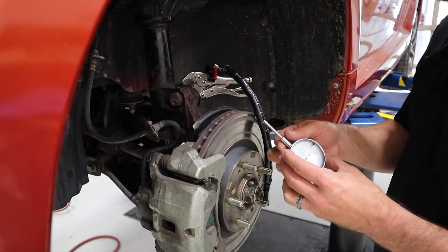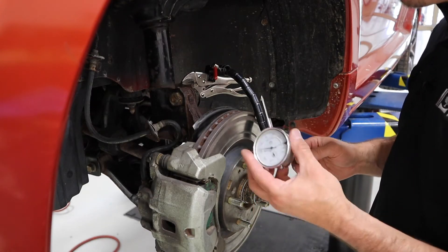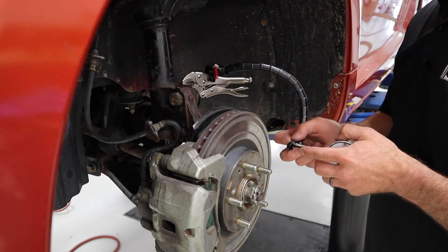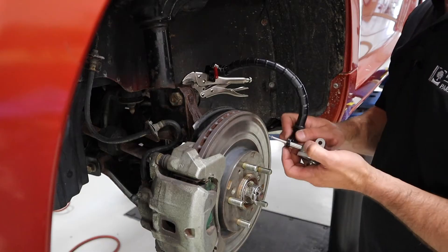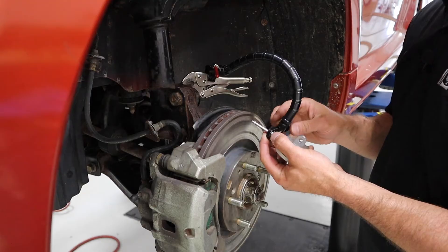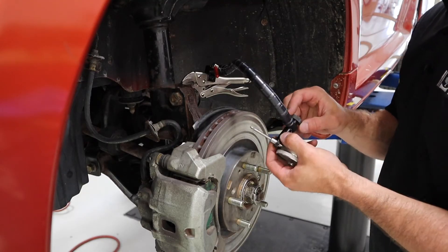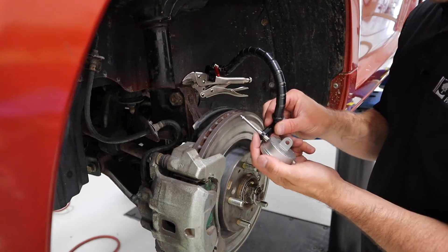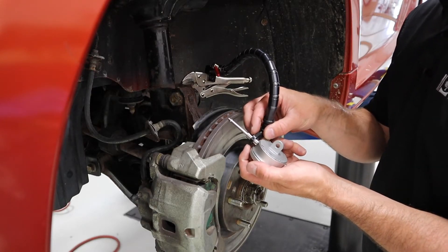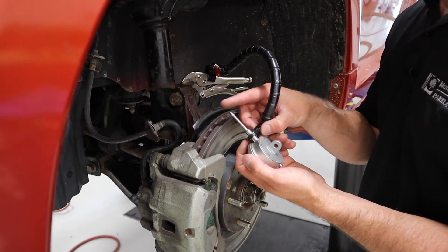Next, bring in the dial indicator — be very cautious, as these are incredibly fragile and easy to break if dropped. Use two hands. Slide the shank into the clamp opening, making sure there's enough slack with the thumb wheel. Clamp onto the collar — the shank — not the portion that moves and needs to stay free.